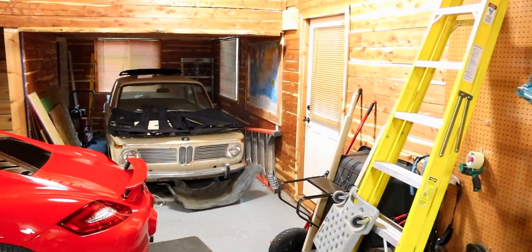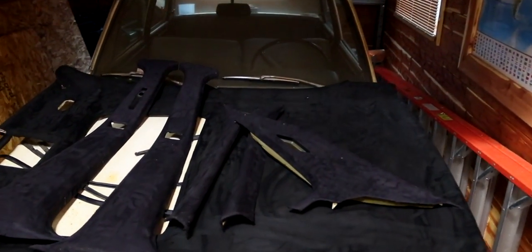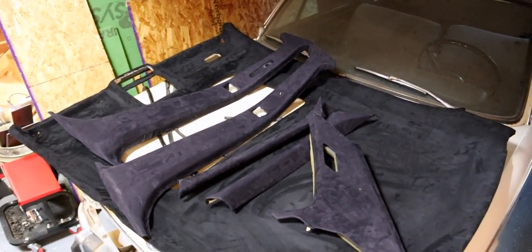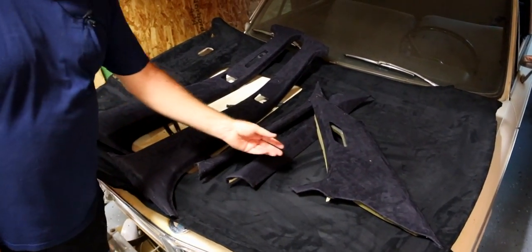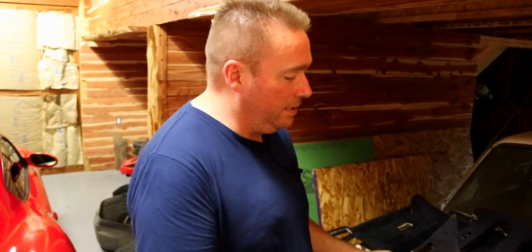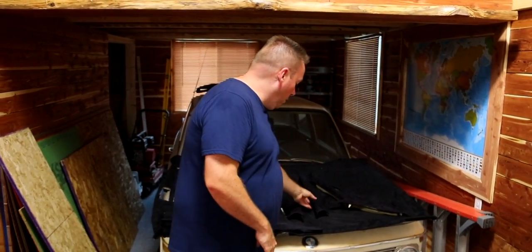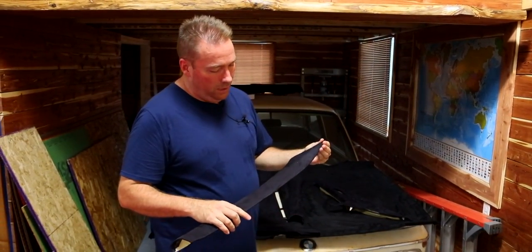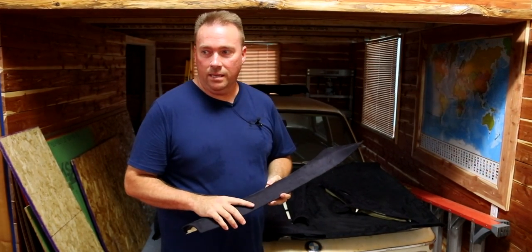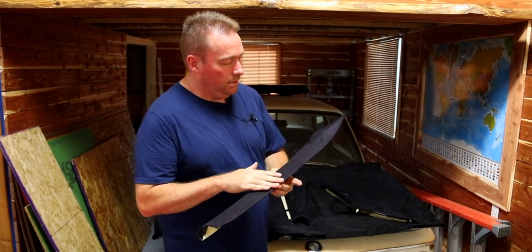Over on the hood of the 1600, we have almost all of the stuff covered. We were missing one C pillar because we ran out of material. Got one tiny little wrinkle there, and there's a lot of tips and tricks to that. It's hard to film this kind of stuff. Basically how these work is you use a spray glue — the 3M spray adhesive headliner stuff. I'll put a link in the description. There's a certain kind that does all the material.